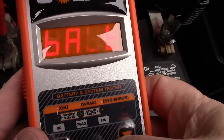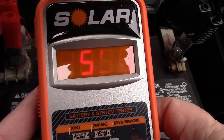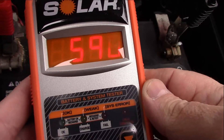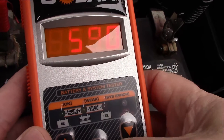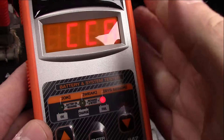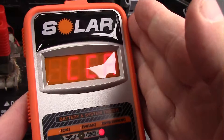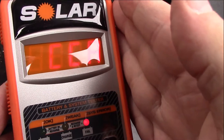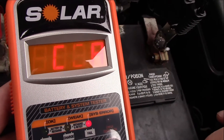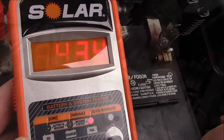I'll disconnect and try it at a higher amount. We'll test the battery again — SL1, cold cranking amps — and we'll up the amperage to 590. And the battery has failed again: 434, which tells us we're down about 150 cold cranking amps on this battery.